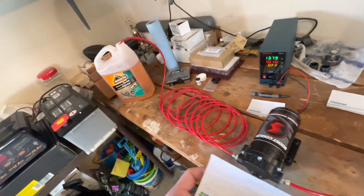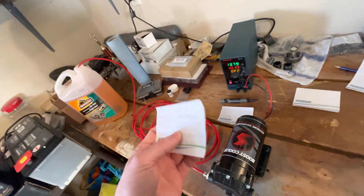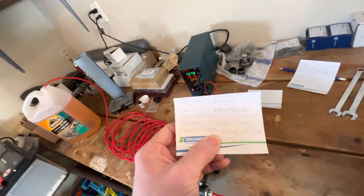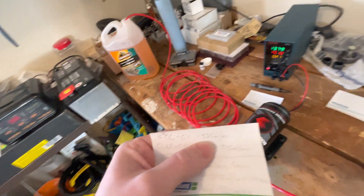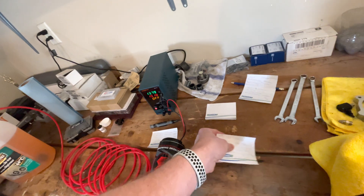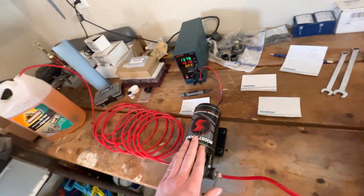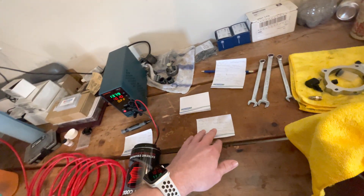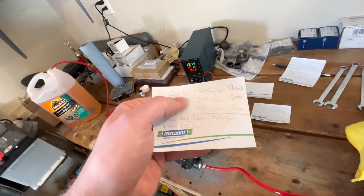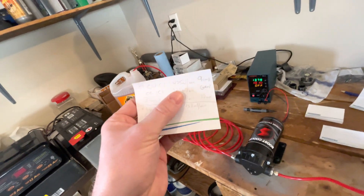So I still have 300 milliliters per minute of room to grow if I need it. If it's not that hot out or I'm not pushing hard, I can turn the set screw to minimum for 775 milliliters per minute. If I'm on a circuit track and seeing detonation, I wind up that screw and have 300 milliliters per minute available on tap. Alternatively, if I only wanted 500 milliliters per minute I could use the number six with a good 200 milliliter buffer.